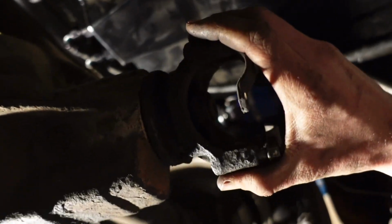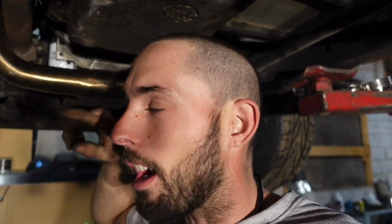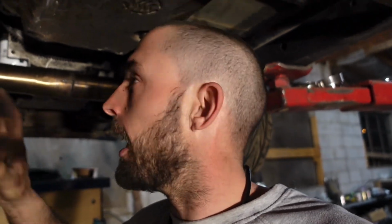It was really horrible. I went back and forth to the parts store about 6 times in one day trading out U-joints. After a bunch of research, I was like, I wonder if we can take this yoke. My brother actually suggested it to me and I blew him off, I was like, that won't work. So I ended up taking a yoke off of the old 4-wheel drive 10 bolt rear end that came in this S10 and bolted the yoke to the front diff, and it worked.